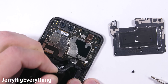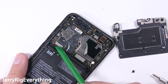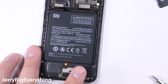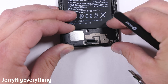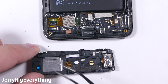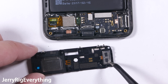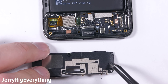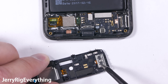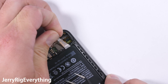The battery is the next thing to disconnect. It's always good practice to disconnect the power on whatever phone you're operating on. Luckily this battery does have those magical pull tabs. Since we already removed the screws for the bottom plastic, it pops off easy enough. Flipping it over exposes the loudspeaker with its two golden contact pads as well as the vibration motor. It's interesting that this is a rectangle vibration motor similar to the iPhones. In pretty much every single other phone I've taken apart besides iPhones, the vibrator is a circle. So that's interesting.